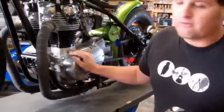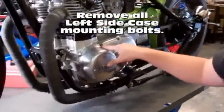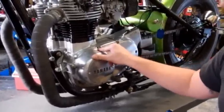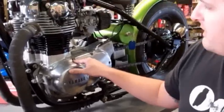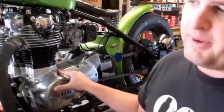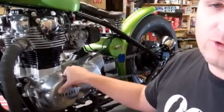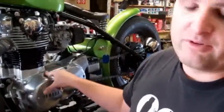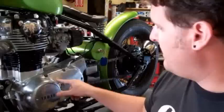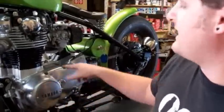I'm just going to give you a quick overview and then we're going to get the bolts off. This engine has been swapped to Allen head bolts that mount the side cases — the originals were Phillips. So if you have an older bike with a completely stock bolt set, you'll probably need one of those impact screwdrivers that you hit with a hammer, because old Phillips head bolts that have been heat cycled millions of times are going to be really stuck. For us, this one's already been converted to Allen heads, so it'll be real easy. You basically need to pull the side case here.